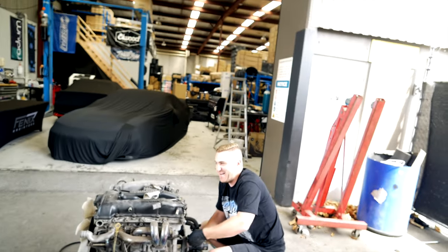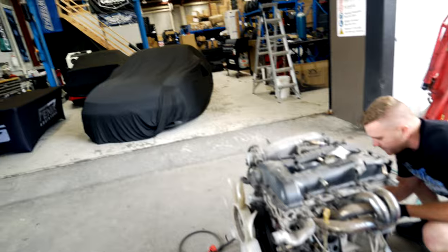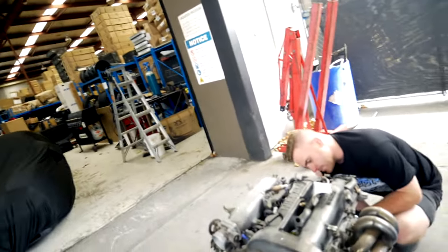This Silvia is going to be kind of like a budget build, but not a budget build. It's only budget because we've got a lot of parts lying around to build another Silvia. The parts are not budget. This engine's basically just a stock SR20 but we are going to pull the head off, put a metal head gasket on it, and vapor blast all the aluminium.